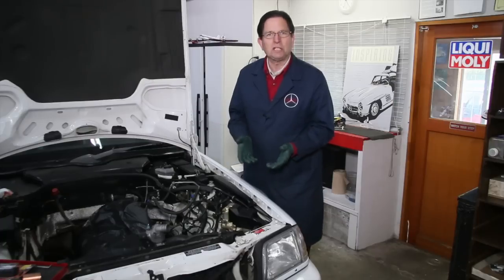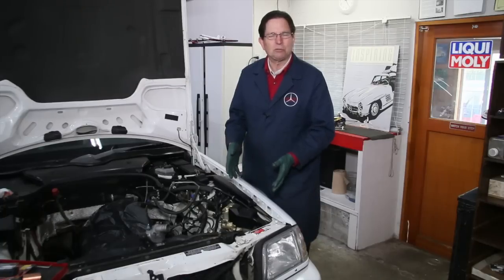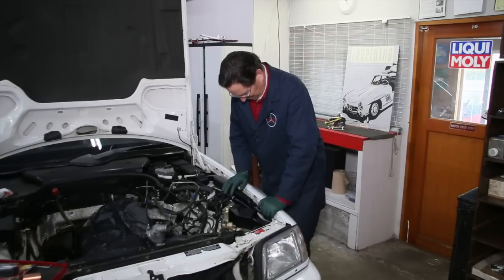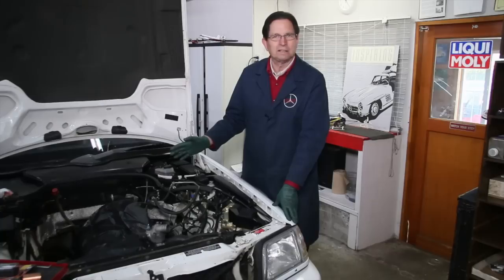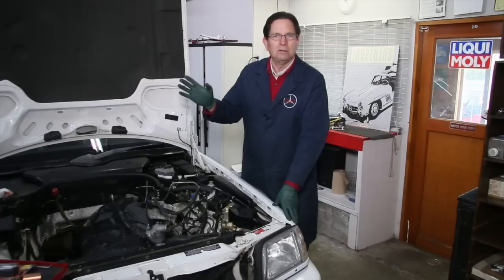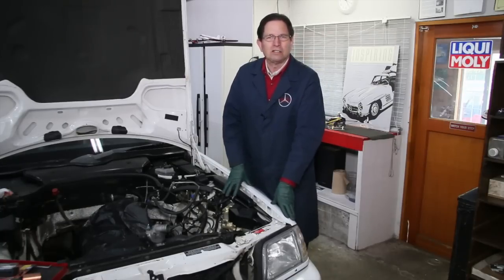Be a little gentle on the clamp — tighten it down tight, and if the hose leaks a little bit, just give it a little more tweak. Don't just reef down on your hose clamps if you have radiators with plastic necks. I'm sure some of you are wondering why I let this happen to my own car, since I've been advising for years to put these reinforcement kits in old plastic radiators. Sometimes I have to bow my head and say I didn't follow my own advice. I made the mistake of thinking the car was so nice I didn't have to worry about it — 100,000 miles, garage car, well kept — and yet when I pulled into the shop to remove that radiator hose, the neck fell off in my hand. I count my blessings that this did not happen when I was driving on the freeway.